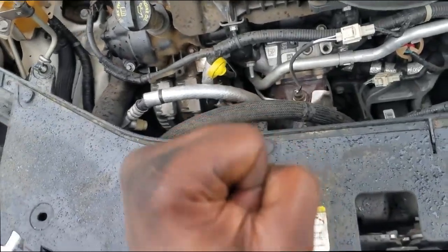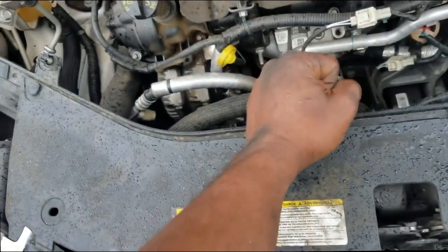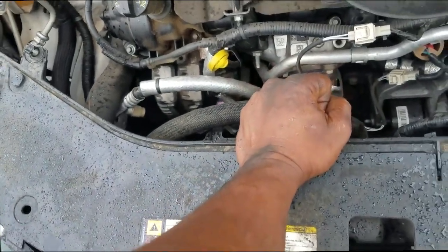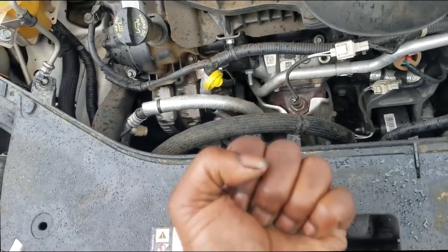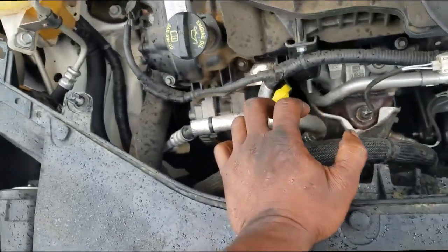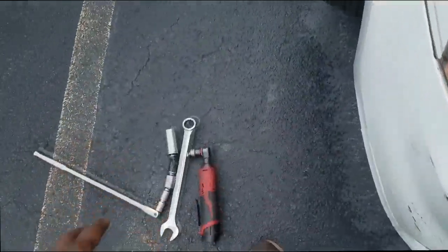I can hear the starter solenoid retract, trying to start the engine. That's what that clicking noise is that you hear. And I can hear it pull back out when the power is snatched away. So I don't really think it's the starter, but I don't know if that's the case or not. I'm about to find out if the engine seized up now.